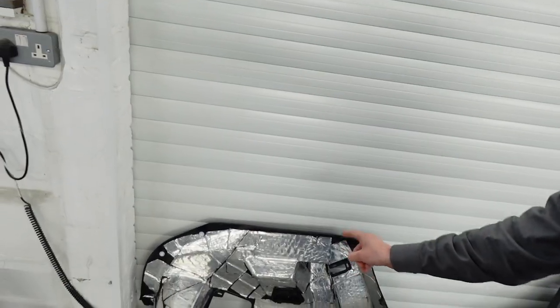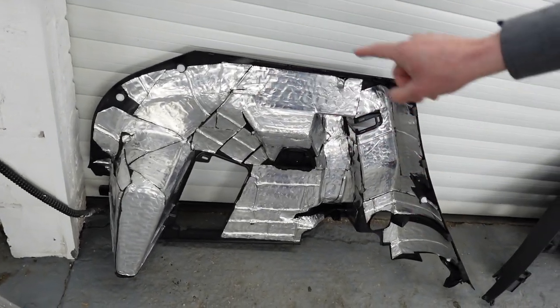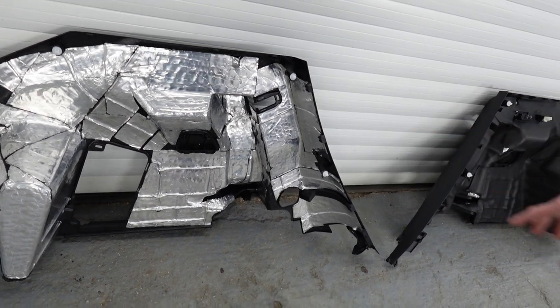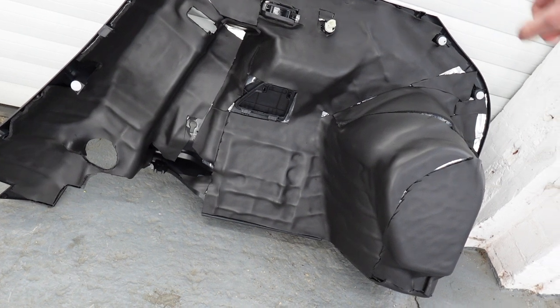What you can see behind me now is the rear quarters that go in the boot on this Yaris Cross — we've first treated them with Skins 3mm on the entire cover of the panel, then covered the whole panel on top of the Skins 3mm with a 5mm firmer acoustic liner. We've also done the same on the door cards: Skins 3mm on the door card first, and then on top of the 3mm we've put the 15mm acoustic liner. Complete 100% coverage. Now we've just got to put the car back together.